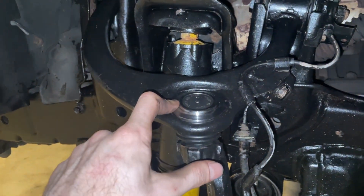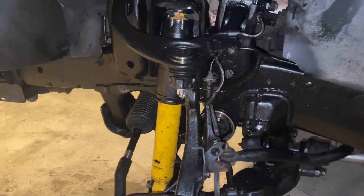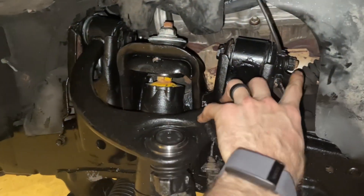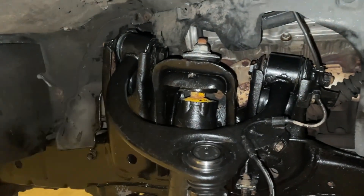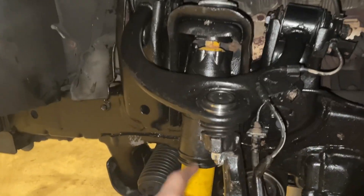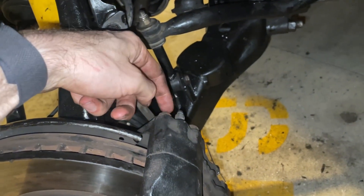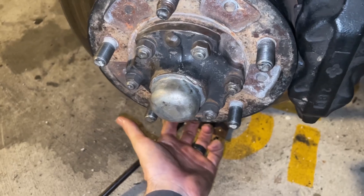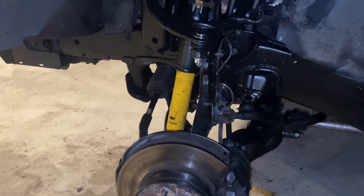I got the ball joint in the mail and pressed in, so the job is finished, although it definitely took longer than I expected. Here are the final torque specs: upper control arm bolts are 72 foot-pounds, 81 foot-pounds for the next one, 90 right there, 91 on both caliper mounting bolts, and 117 foot-pounds at the bottom. That's it guys, thanks for watching.